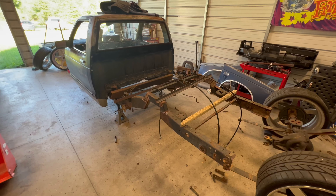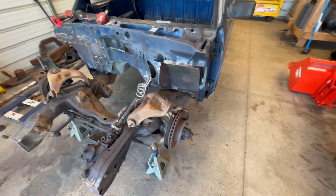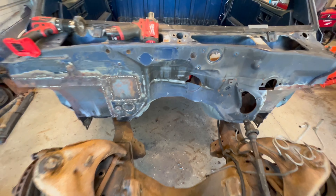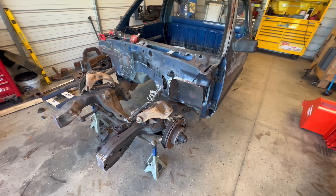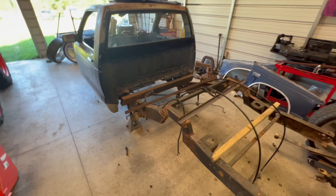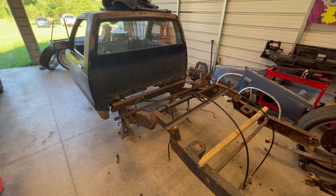I will have to narrow the gas tank cross member but other than that everything else should bolt up to the frame rails like I want. That's what we're going to try. Got the bed off this thing. I've got a six link coming from Phil over at Twisted Images — spoke to him on the phone yesterday. The wheels will not fit between the frame rail and the bed, so we're going to narrow these chassis rails and modify that six link to work.